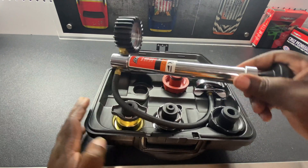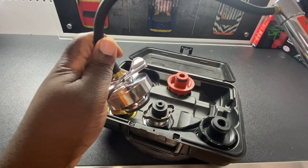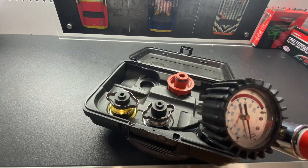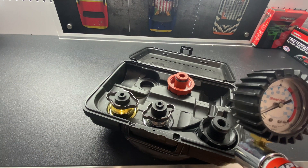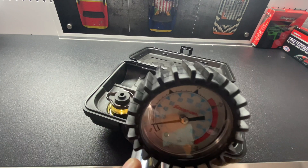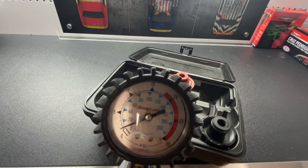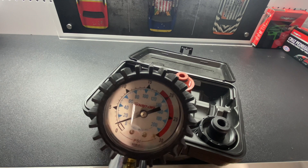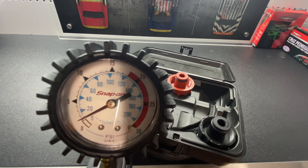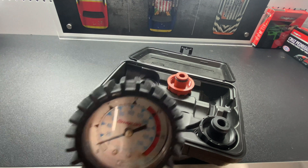So here it is. They've got the radiator cap with little cams to lock it down. It also has this tester gauge right here that you use to put in the pressure. Usually you don't want to go over 30 PSI — if you go over 30 PSI it's going to automatically bleed off the pressure. Check with your manufacturer to see what your system holds, don't go over 30 PSI, and always do this while the vehicle is cold.